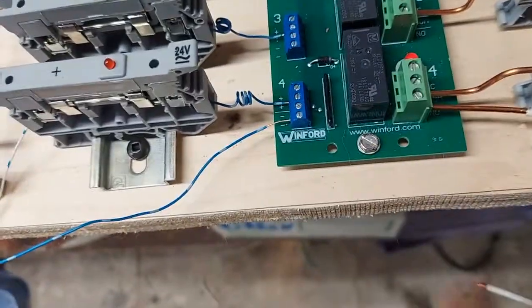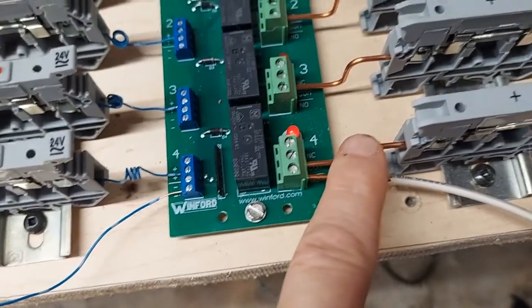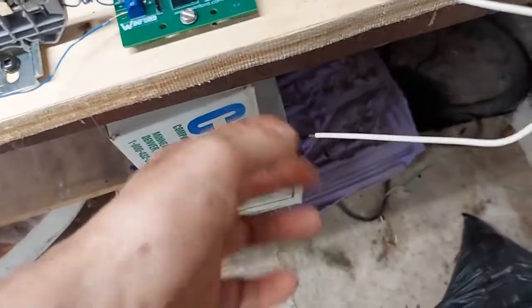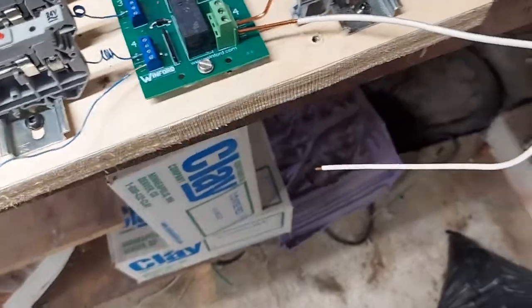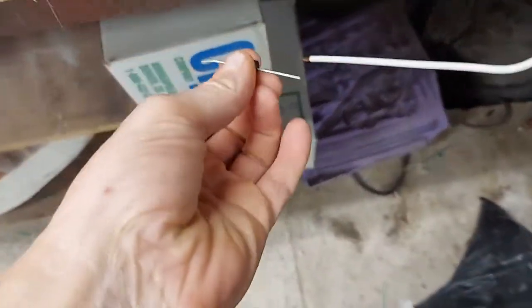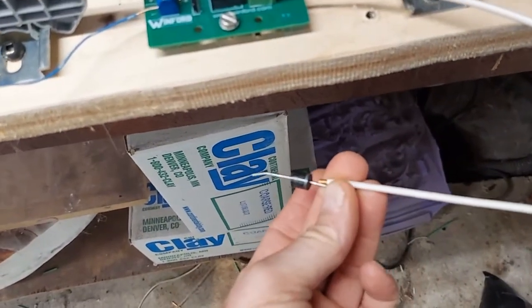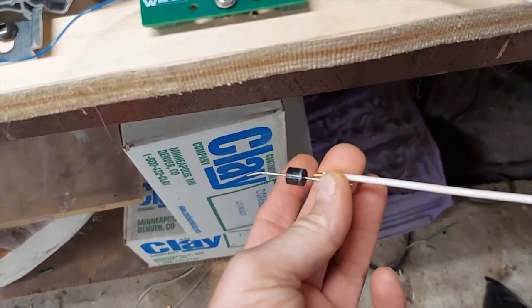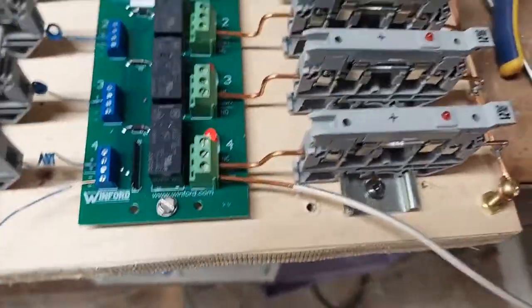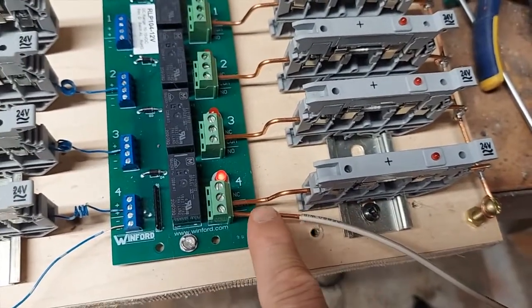Here in the green block, between this wire and that wire — this wire is just a test wire, but normally this wire would have a diode on it so that it can only go one way, just to make sure everything is electrically separated. It has a diode in there, and then that goes up to each rank on the organ.